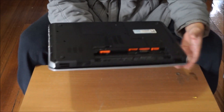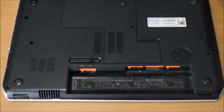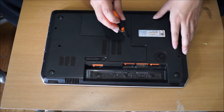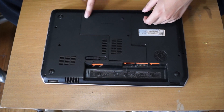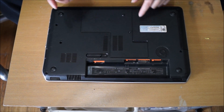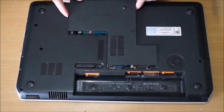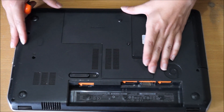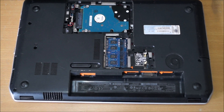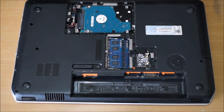Flip to the back where we start. Remove your battery if you haven't — there are three screws under it. We're going to remove one screw here to remove the quick access back panel. This shows you your hard drive, your two RAM slots, and your wireless card, and gives you access to remove your DVD drive. Slide it up and take it off — the screw stays on.